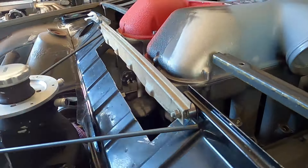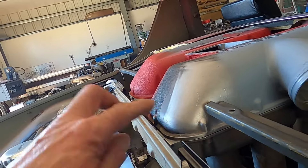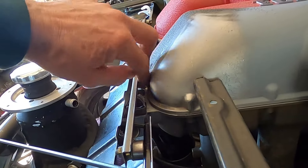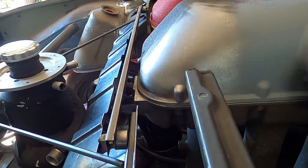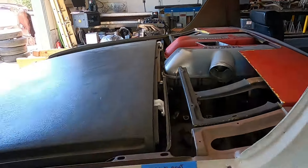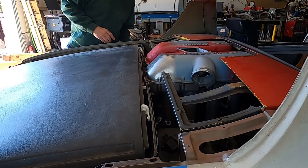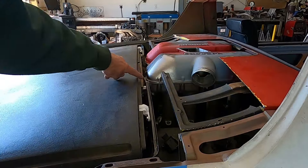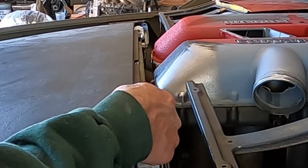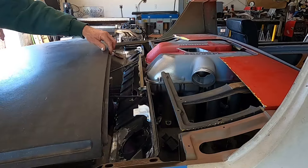I cut a length of quarter-inch steel rod, marked the center line, and using one of the bending dies from the hydraulic bender, worked it around the die to get a nice radius. Then I sectioned out the middle section of the old original sheet metal, fixtured it in at the same height, spaced it back, and now there's plenty of clearance everywhere — mostly where the interference was before. I've got room for my seal and clearance, so that worked out great. Now all I've got to do is tie this in here with a seal and make a little S-channel.